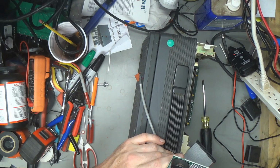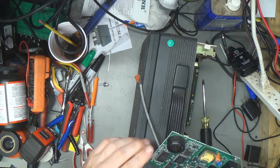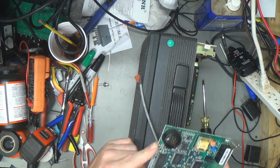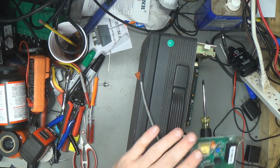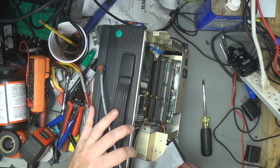Everything's surface mounted. That's probably some kind of WIN modem. It doesn't have a separate UART on it. Nothing useful to salvage from there, although that speaker and audio coupling transformer might be useful for something. Parts is parts. Okay.